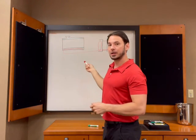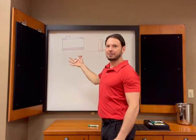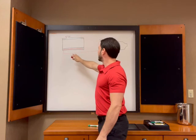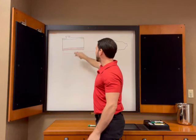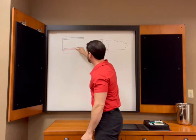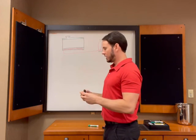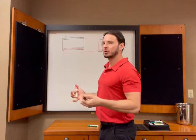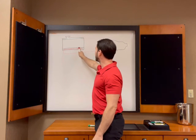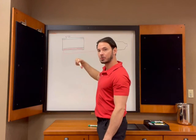And what's it gonna do in there? Well, as I said, this pipe is call it half an inch. It's definitely larger than the lines going to it. So basically what I'm gonna do in here is slow the fluid down a little bit and allow some fluid to pool in there, sort of like a reservoir. And why am I gonna do that? Well, obviously what I'm trying to do is transfer heat either to this copper pipe or from this copper pipe to my transmission fluid.